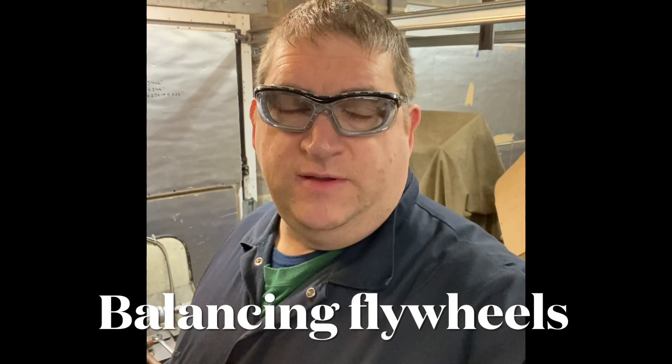Morning all, this video is about balancing flywheels. There are a couple of ways of doing this: one is to use the services of a machine shop which has a proper dynamic balancer, and another way is the way I've been doing it for the last 30 years, which is static balance. It's perfectly possible to static balance a flywheel for a classic Mini because the flywheel itself is not long like a crankshaft. The crankshaft, being a long item, can be out of balance in a number of places along its length. Whereas the flywheel, being larger in diameter than it is long, has balance planes much closer together, so it responds well to static balancing. I've been doing it for 30 years and had a lot of feedback to say how smooth the engines run. I would listen to what I've got to say, but make up your own mind as to what you want to do regarding balancing.